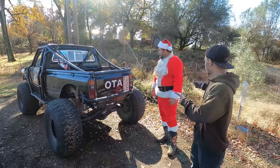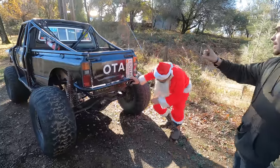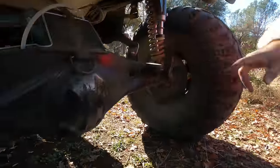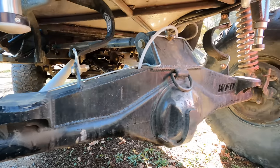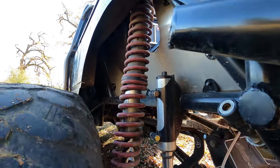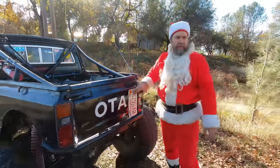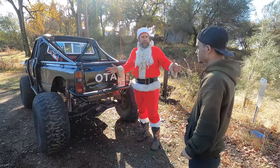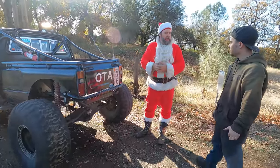113 is the honey. When we did the stretch, the wheel well on the bedside wouldn't match, so I got a long-bed bedside and cut it to fit. In the back we've got our WFO truss — the only one made, not on the website. Dual triangulated four-link, 2.0 coil overs in the back — 14-inch travel. And it's registered for 2023 — this thing is a driver. He drove it to work today. I love that our guys are building stuff you drive up there, wheel it, and drive it home.